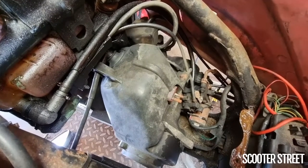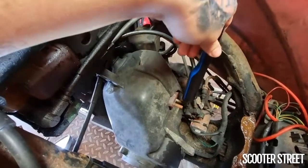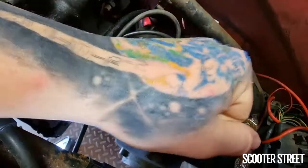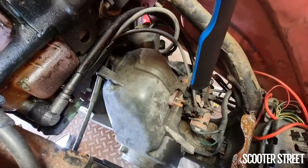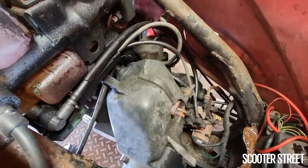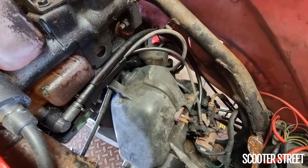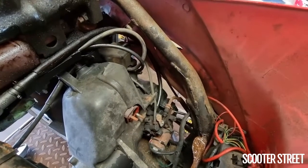What classically happens with these is they develop a really bad carbon buildup in the top of the header right here, which eventually just gets smaller and smaller until your exhaust gas is trying to fly out of the tiniest little hole imaginable — like the size of a straw — instead of the full size of the exhaust port, and the bike just gets excessively slow. This customer has come in today complaining of exactly this problem. The bike's ridiculously slow, and this is the first place I've looked, and seen straight away that the exhaust port is about the size of a straw.